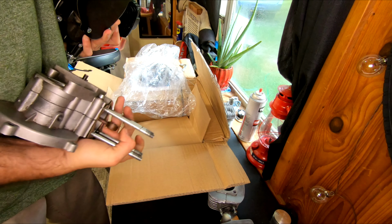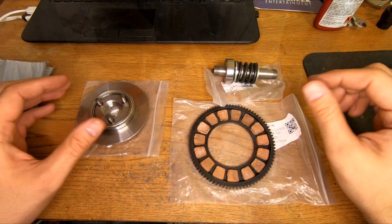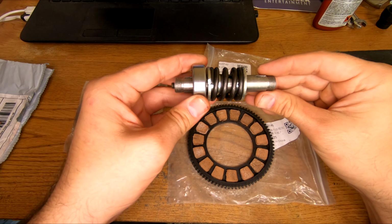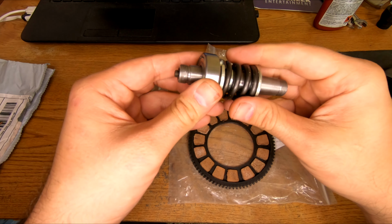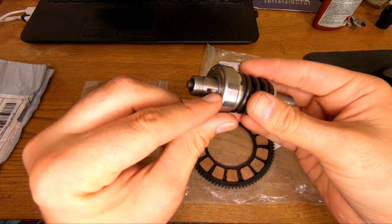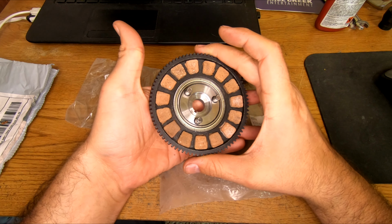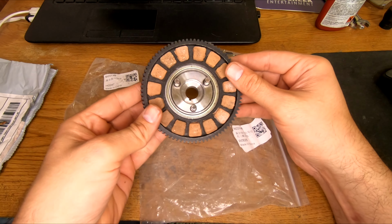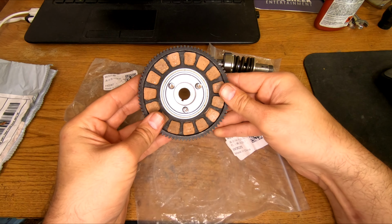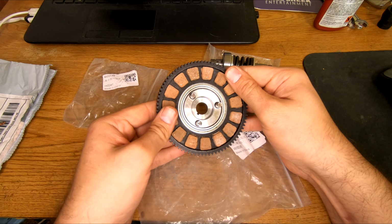As a gift for those of you who made it to the end of the video, I found a part which will come in handy for some of you. Once I had bearing failures on a clutch basket during a ride, which caused all the little tiny bearings to fall out of the clutch basket. Well, on Amazon for about $22 and 2 weeks shipping, I found this. It has a shielded, contained bearing set for the basket, and looks pretty well machined in my opinion. This means maintenance and longevity should be a big improvement over the stock clutch basket. Leave a link in the description.